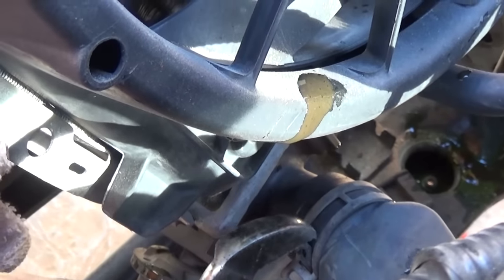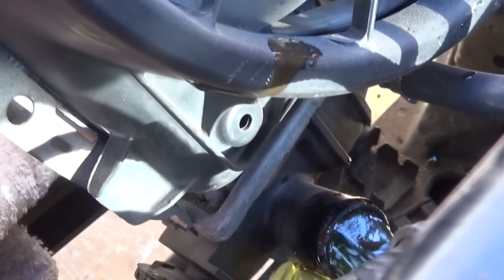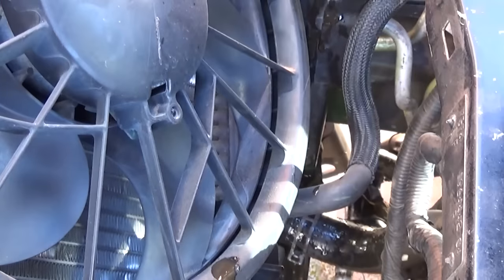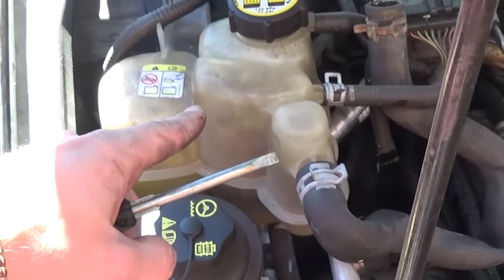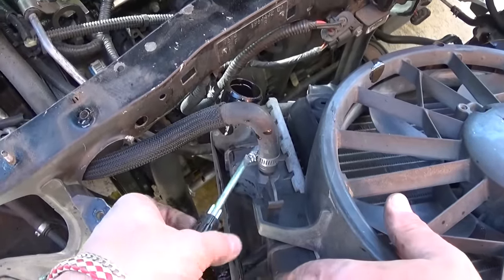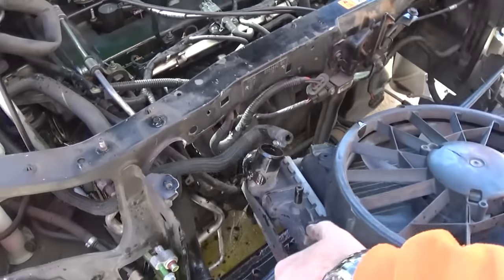That clamp is the one holding right now, and those are really, really powerful. We have some coolant here as you can see. Now there is one more little hose that we need to remove — this is a radiator hose coming from the coolant bottle. With a flat head screwdriver, remove the clamp on this one, loosen it all the way, and pull it out.